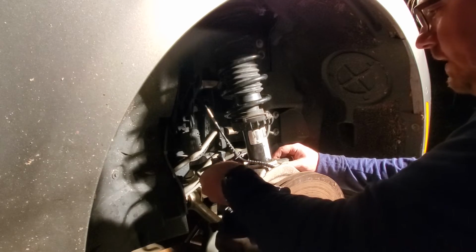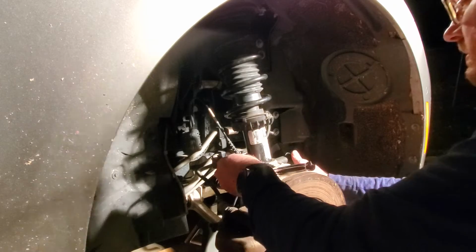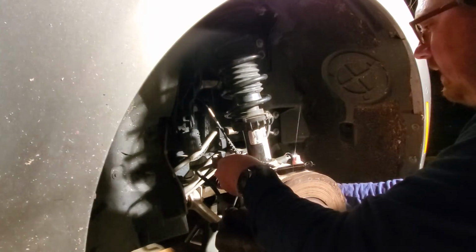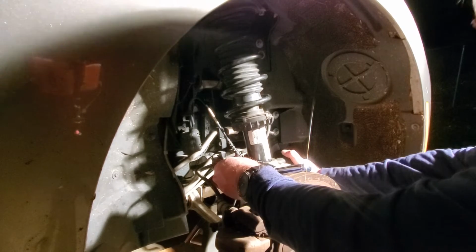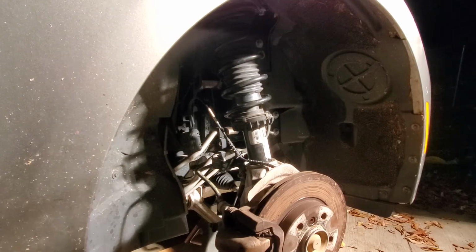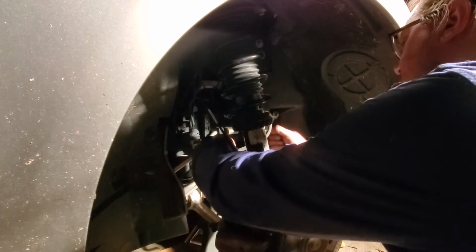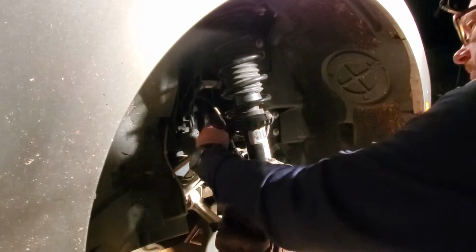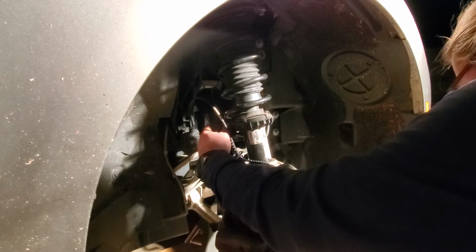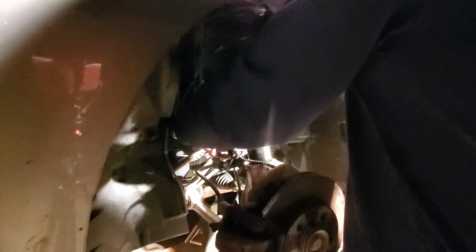So that was unique. But after all of that and finding strut repair, I finally figured out the torque specs. Then I had to convert Newton meters to pound feet. And I did not look up the stabilizer link and its repair procedure to see what this nut went on as. But I can't imagine it's going to be any more than what they have listed here for the other ones. So I'm going to say it's like 33, 40 foot-pounds.